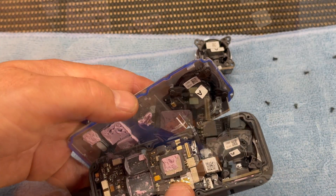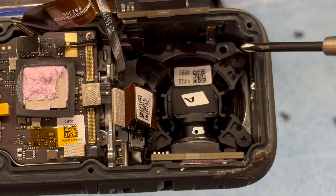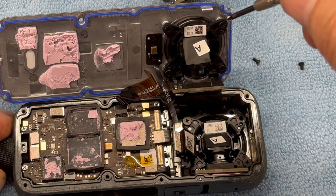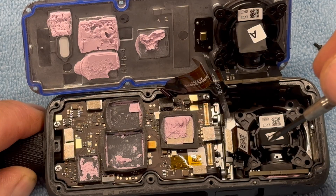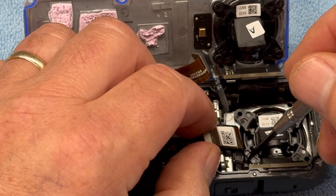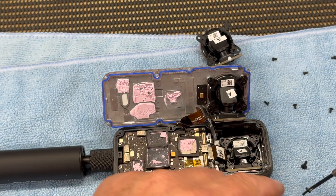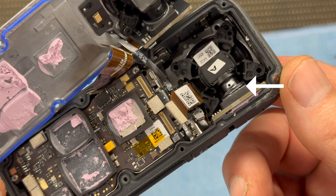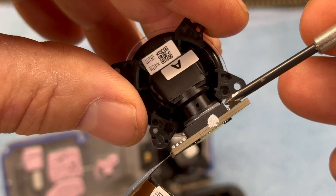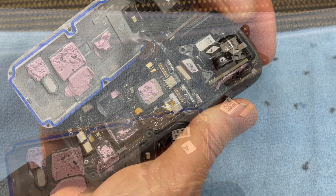What we have to do now is remove the ribbon connector for the damaged camera lens unit, then remove the four screws connecting the lens camera unit to the body of the device. For the fourth screw I just had to go in at an angle — be careful not to damage any electrical contacts. And here you can see the damage to the lens camera unit: it should not look like that. The vibration has clearly caused it to crack, causing the blurriness and the out-of-focus picture.